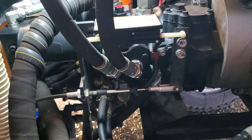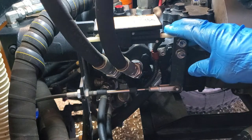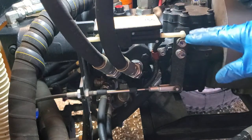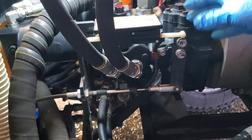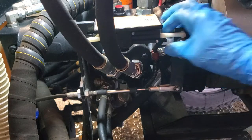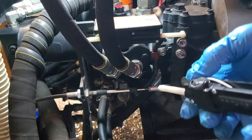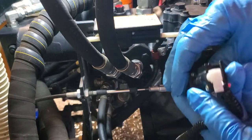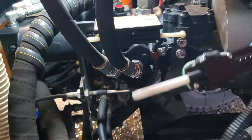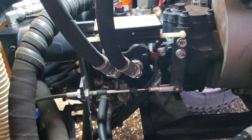Hey, what's good everyone, request man here. Look at the neutral safety switch right here, just underneath the emergency bypass instructions. In a previous video when I thought the starter was broken, it turned out to be this. Jiggling these two wires right here — actually one here on the side — jiggling those two wires got it to start. Got this thing in a couple days ago, so it's time to change it out.